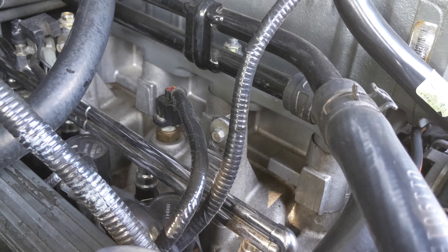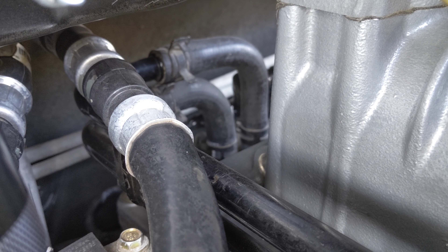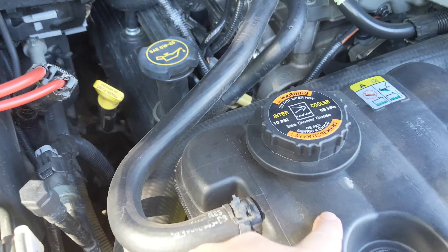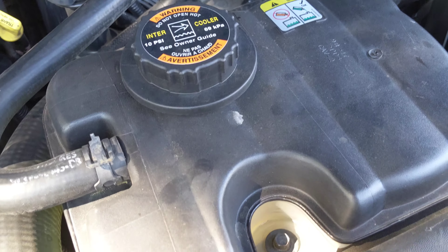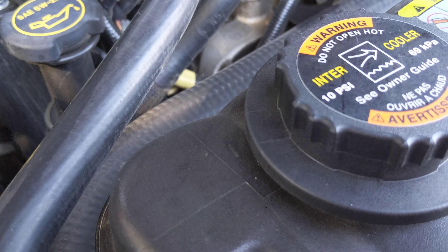In the back you can see those two little hoses — one is the inlet and one is the outlet. The one on top is the outlet coming back from the supercharger. It comes out of there, across this top tube, and into the intercooler reservoir where the excess coolant sits. At the bottom of the reservoir there's a hose that drops down to the pump inlet.